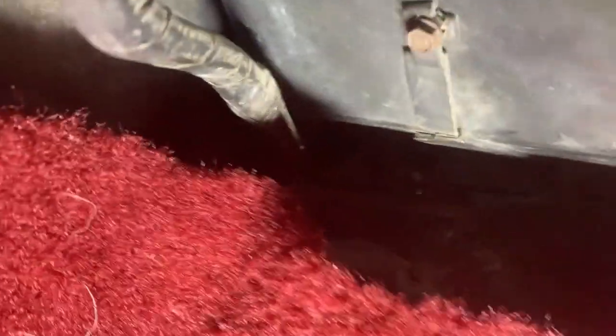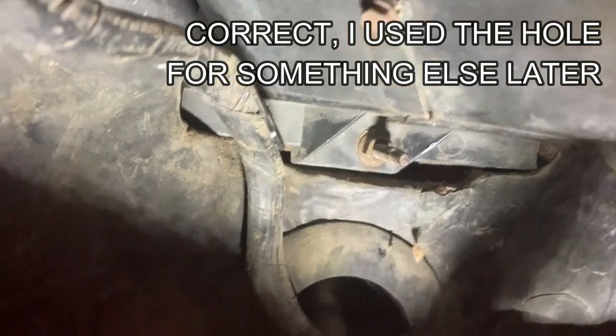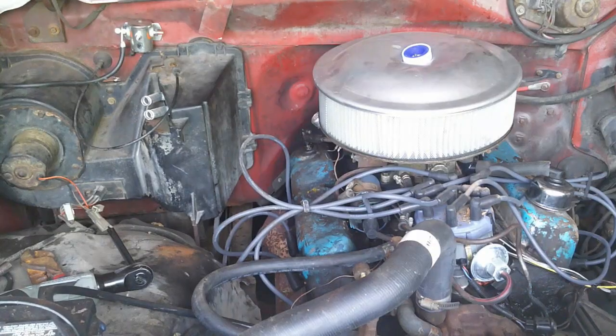All right, up right there, that is where you bolt in the heater core. That's the nut on the back. And I'm guessing somewhere up behind the glove box is where that other one that somebody cut off is. I'm not sure, but nonetheless, this is where it is. And you just need a deep well to get to it. I find that both a 3/8 and a 10 millimeter worked on it, so not really sure which one it is, but they both worked, so. Anyway, that is that. So we got the new one in.